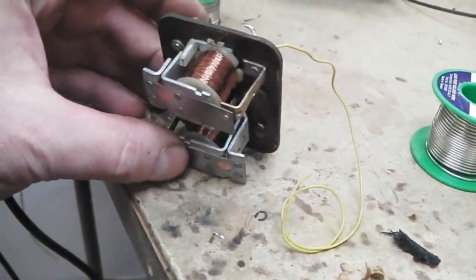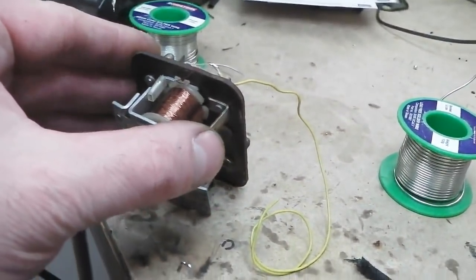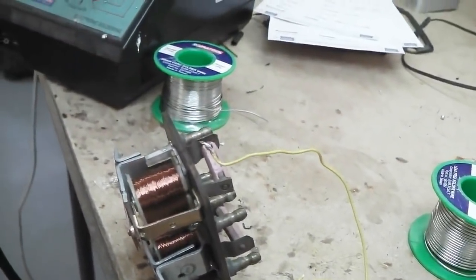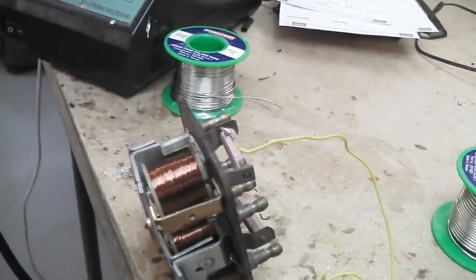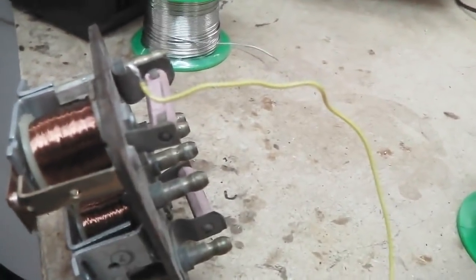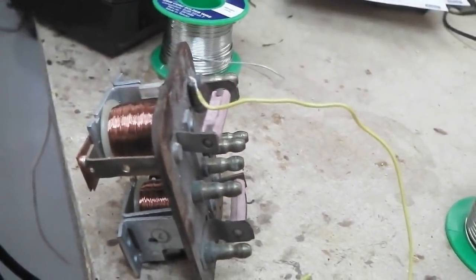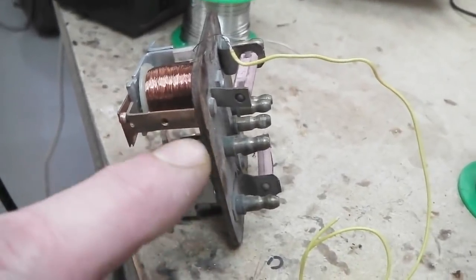You've got a high beam relay and a dip beam relay, controlled by the stalk and the lamp switch combined. You need your stalk in the loom when you're testing this, because no stalk connected into the loom means you don't get power through. So connect your stalk up. If you're doing this on the bench, your steering column stalk, the indicator stalk, has to have its loom on so that all the power can get to the right places.